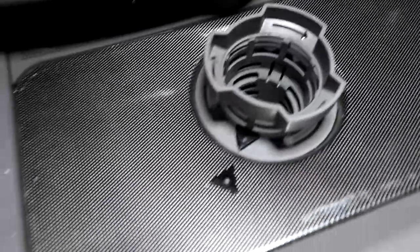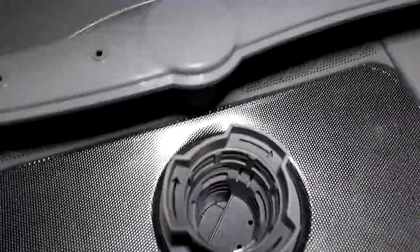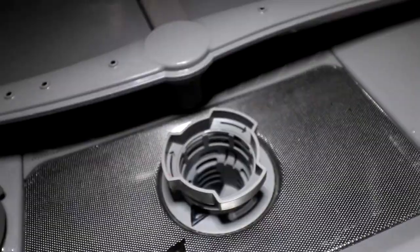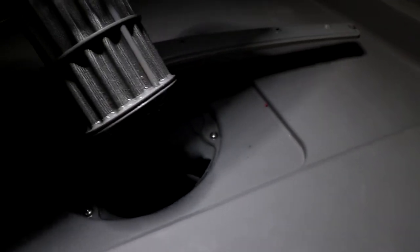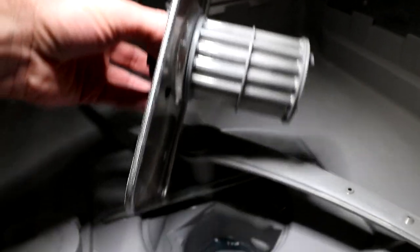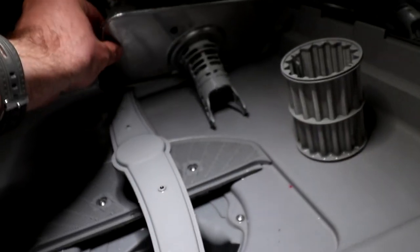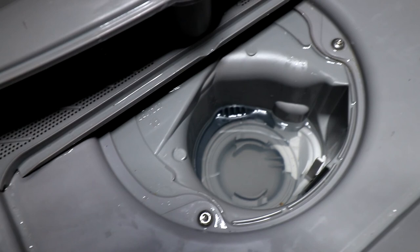A bit of bonus footage showing you the filters. This is what it looks like in its normal mode. Normally the water only comes up to roughly around here — it's not supposed to spill over. Things can fall down there, and in my case those peanuts fell down there, made their way past the impeller, and got jammed in the piping. Normally they would have gone all the way through, but because there was a narrowing in the pipe, that's what happened. When that's in, just turn it anti-clockwise, lift it out — there's your filter assembly, all cleaned. Then you can separate it just by pulling it apart, give the two pieces a clean, and this is the inside — that's kind of the sump.